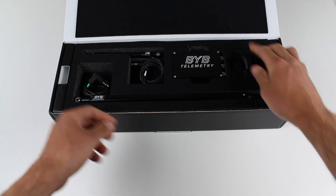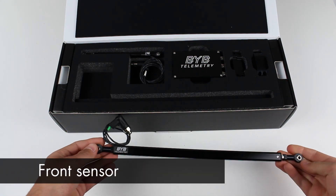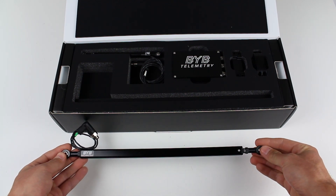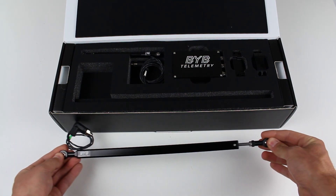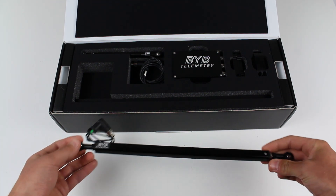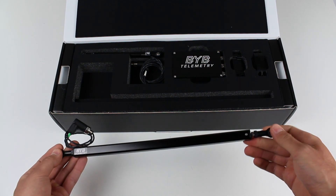Then we have a 200 mm motorsport grade anodized front sensor for the MTB kit, while the MX kit includes the longer 350 mm sensor. They are characterized by a low-actuation force, IP65 sealing, self-alignment joints and a super compact body in order to make their installation as simple as possible.